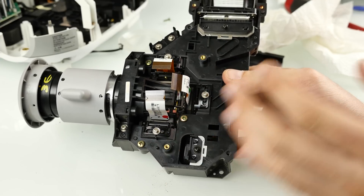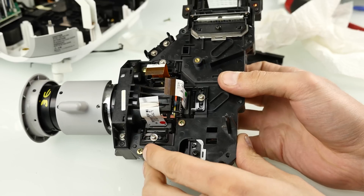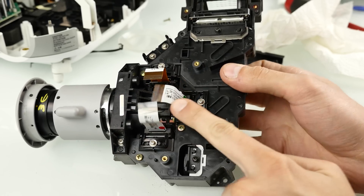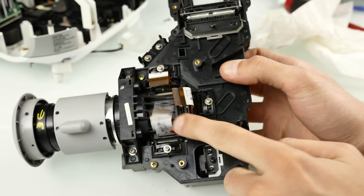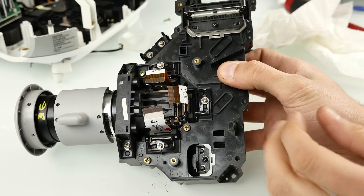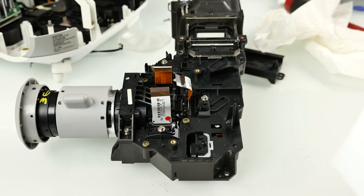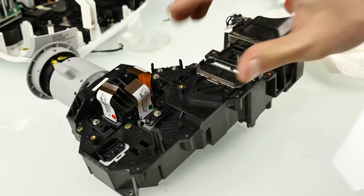So basically very tiny displays. They are displaying the input in grayscale and very tiny. The light then tints the picture — that means that one will be a red tint, that one will be a green tint, and that one a blue tint. Then there's a prism inside that focuses all of them back together — it combines them. Then through the lens it gets projected onto your wall. That's how such a three LCD projector works, the basics.